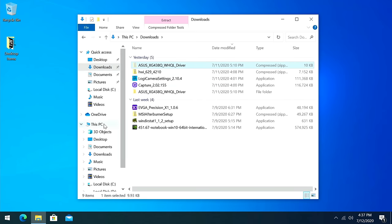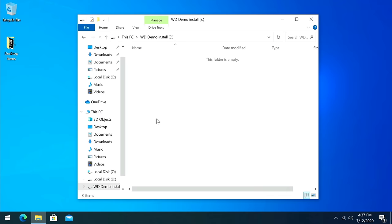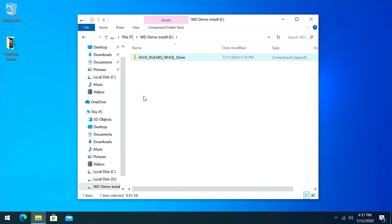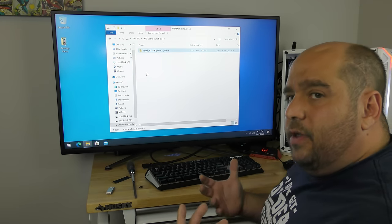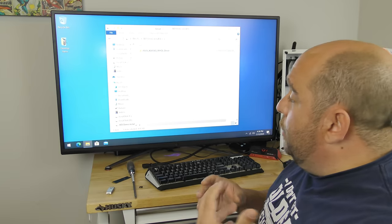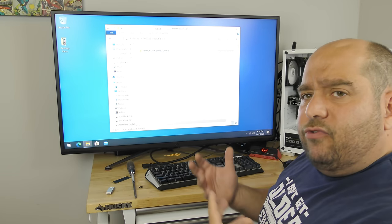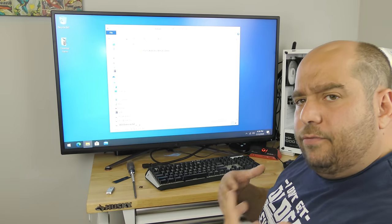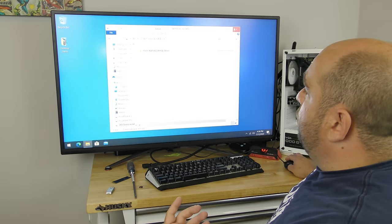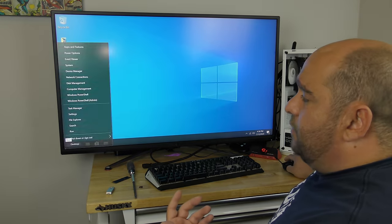If we wanted to save some space, I'll go ahead and grab one file, click on that file, go to that drive I just created, paste — and now it's out of my C drive into my E drive, saving some space. You're going to want to move a lot more than just one file, but just to give you an example. Now you can install games, applications, use it for storage — whatever you like. Now I'm going to show you how to install Windows 10 on it.